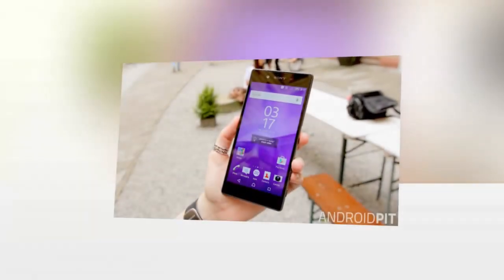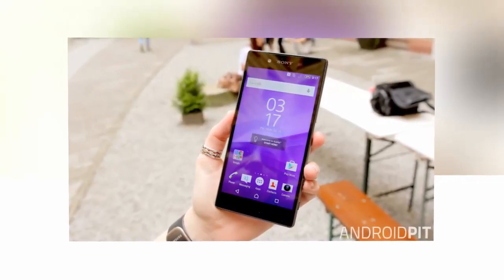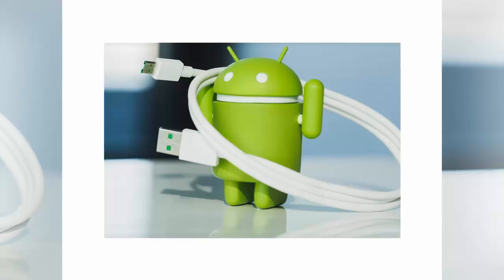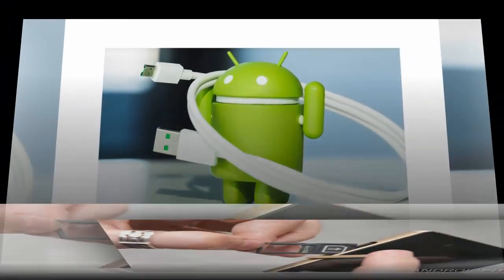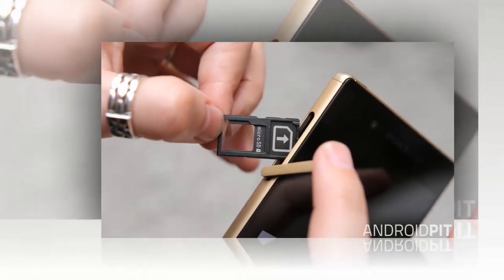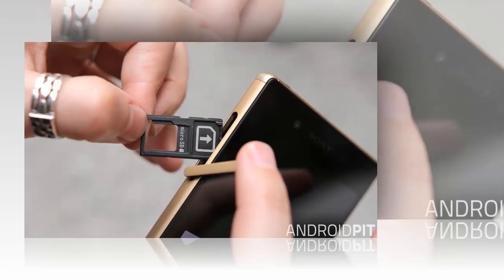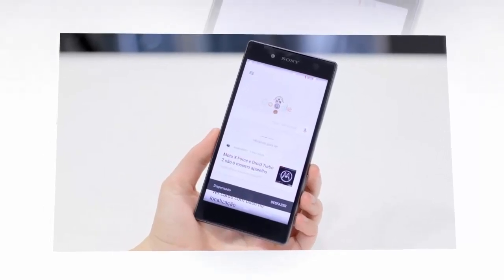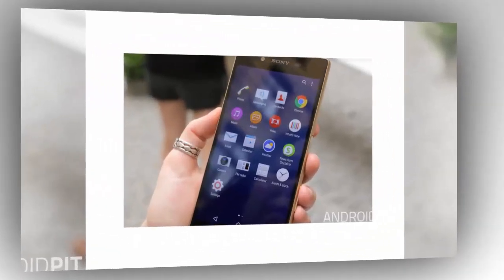Using Sony's own Xperia Diagnostics application, it's possible to carry out a test to see if the phone identifies the problem itself. From the Sony Xperia Z5's home screen, head to Settings > About Phone > Diagnostics > Test. Follow the on-screen instructions and await results with crossed fingers. The free-to-download PC Companion app is a great resource for resetting the Sony Xperia Z5, so we recommend you grab the tool yourself and browse through its repair menu. Sony notes that content stored on an external SD card, such as photos, videos and music, is not deleted when using the software. Sony Xperia Z5 phone calls sound bad.